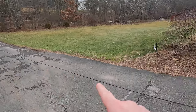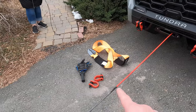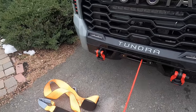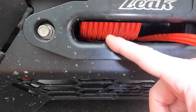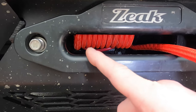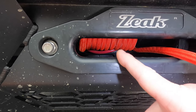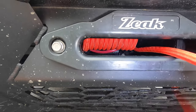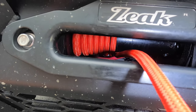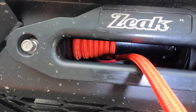You can see all the rope is extended, but I want to show you one thing. When you come up here, you can see the rope changes color at a certain point. Most winches do that and I love it, because that gives you a warning — you don't want to go out much farther. So if we look inside the drum here, you can see we're down to the last row of coils on the drum. I am going to pull out a little bit further. You want about, like I mentioned, a minimum of five to six wraps around that drum. Now we have about seven wraps left on the drum — we're going to stop right there. With a synthetic rope especially, anywhere in that area — six, seven, eight, maybe even nine or ten wraps around the drum — is a good place to start to get this tension going. Don't ever go below five or six wraps, especially with synthetic rope.